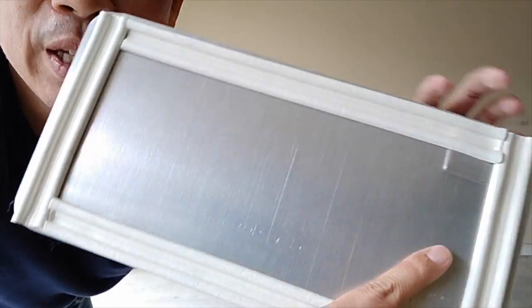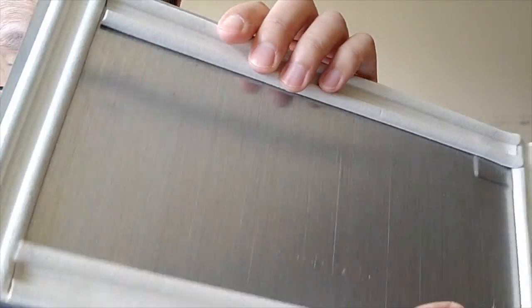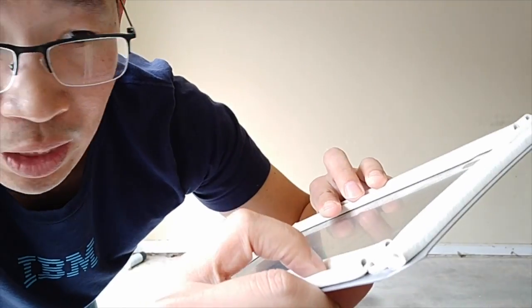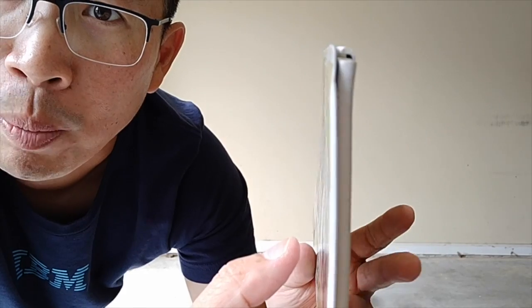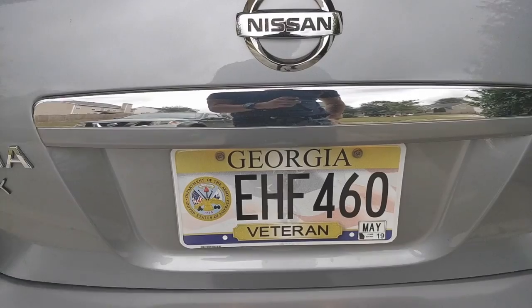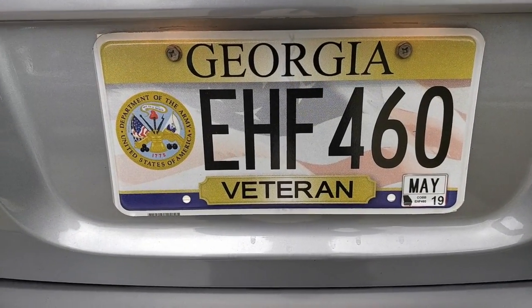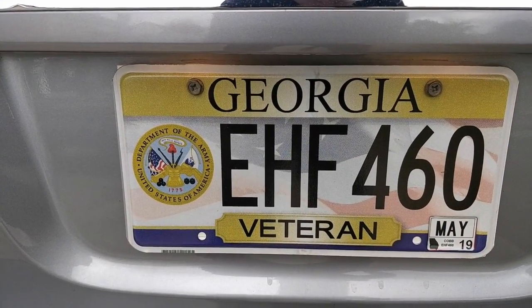So I'm going to put the rest of it on. We're back — I finished weatherstripping the whole back of this thing. You can see from the top how much thicker this is. The screws are going in here and I've already covered it, so I'm probably just going to have to punch through that. You can see how much thicker this plate is now, and hopefully as the bass kicks in it's going to hit this weatherstripping and just deaden that sound. So let's go ahead and put this license plate back on and let's get ready to rumble. The two screws just take a little bit of elbow grease to punch right through that weatherstripping, but it's ready to go.